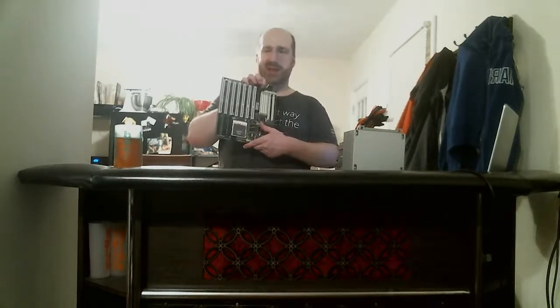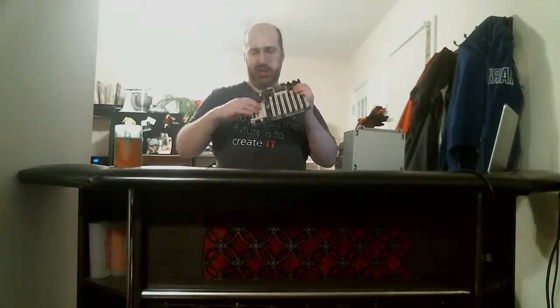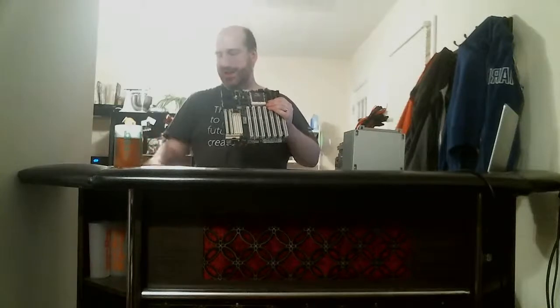So yeah, having the board already with that socket saves me the trouble of dealing with a soldering iron on this thing. And then also, this has two types of memory sockets here. And these longer ones are the 72-pin ones, which are the newer technology between the two. And so this gives us the option of putting in 8 meg sticks. And I have a pair of 8 meg sticks. Let's not get nuts here. So we're going to put in 16 megs of RAM on this, which is probably overkill for a 486, but hey, why not?